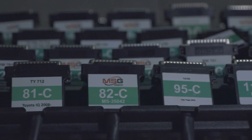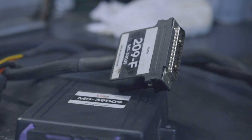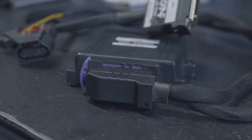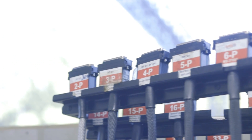With the universal cable you can diagnose almost 80% of all steering units which work on CAN-BUS and PWM. You cannot connect with the universal cable FlexRay units, Japanese racks which use a separate electronic steering control unit, and some steering pumps which have special signals for angle sensors.